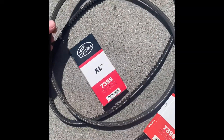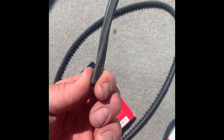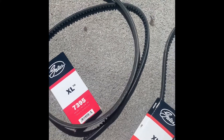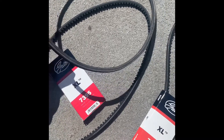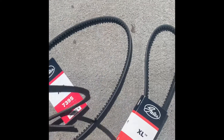The original belt was very loose and smoked — squeal and that kind of thing — so I just wanted to cut it off. I did measure it flat with the tape. Outside top edge measured right at about 39 inches, so not sure exactly why the fitment guides say 39 and a half or 40.